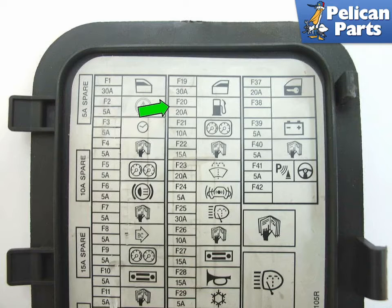We're going to be working around fuel here, so we want to take some basic precautions. As always, you should be wearing your safety glasses, and now is a good time to get yourself a pair of chemical-resistant gloves. Work in a well-ventilated area away from any source of ignition — meaning open flame, incandescent shop lights, or hot water heaters. You should have a properly rated, fully charged fire extinguisher on hand and know how to use it.